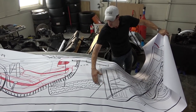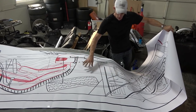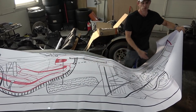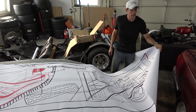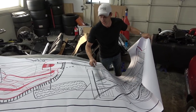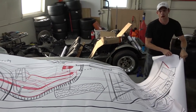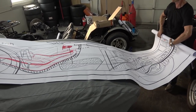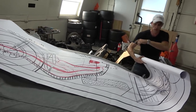So in my car, I will be directing air from below — much like how the front of a Can-Am car or a Chaparral in the '60s would get air from the front. I'm most likely going to put a radiator behind the driver in a compartment where it'll come in from below, go through the radiator, through the engine bay as in any typical front-engine car, and direct out the lower pressure in the back.